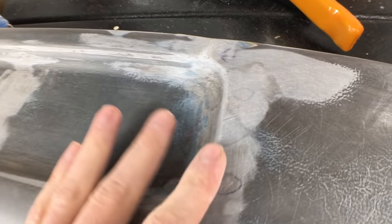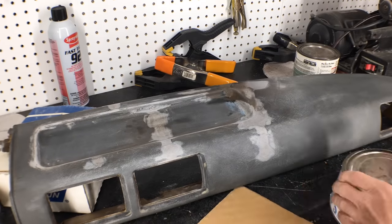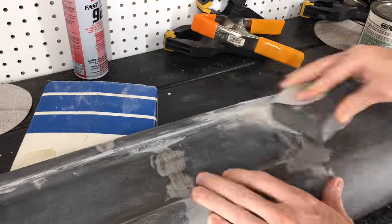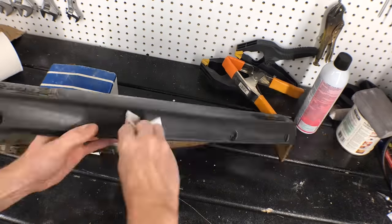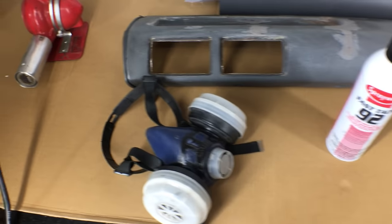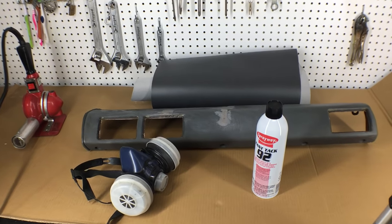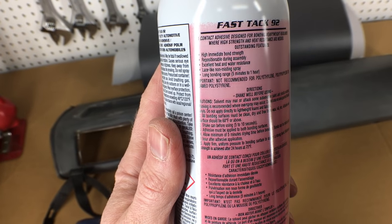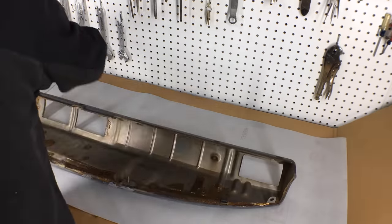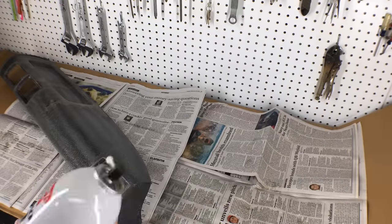Feels smooth — there's an ever so slight low spot right here. That'll do. Next I cleaned the whole dash with prep spray to remove any dust and contaminants. Now it's time for vinyl. I've got some cardboard down, half mask, heat gun, and the vinyl, and the FastTac 92 by Sprayway — I'll have links to all these products in the description. This is an aerosol contact cement and it needs to sit for at least 5 minutes after being applied before I put the vinyl on the dash. First I outline the dash onto the back of the vinyl so I don't spray more area than needed. Next, I put down some paper and sprayed the entire dash and let everything sit for 5 minutes.